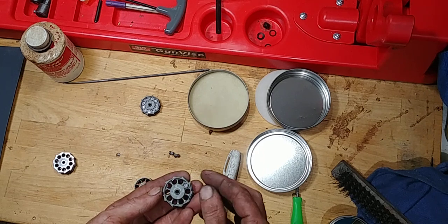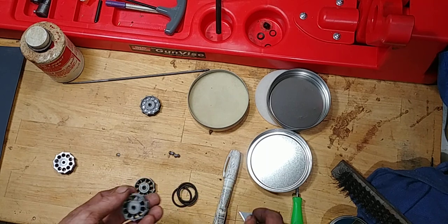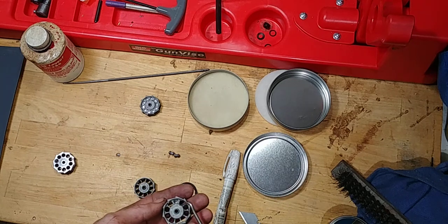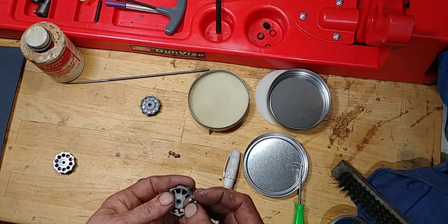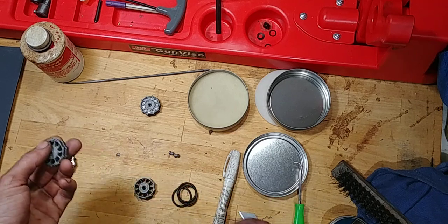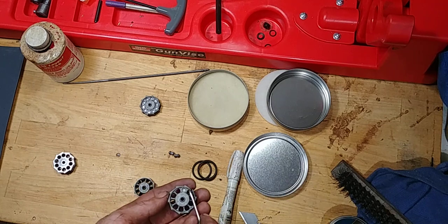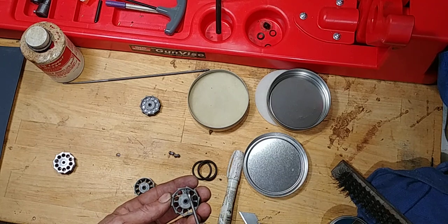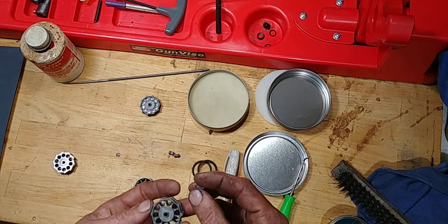See, that one's sticking also. That one's sticking. This one I haven't worked yet. But these should actually fall right through. The only thing that should hold these pellets in are the O-rings. So as the pellet is getting pushed in, you're getting damage on the skirt and you could be damaging the head.